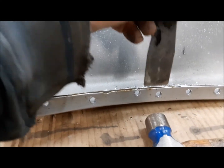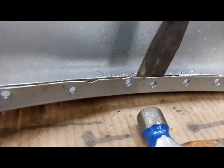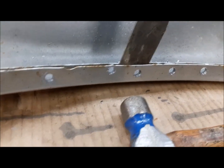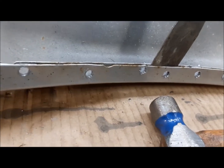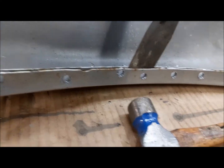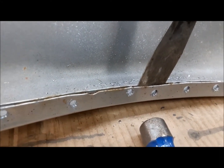Now we just start working it easy with a putty knife and a small hammer. I've gotten these three popped already, and you just keep working your way up and down. Some of them we might have to drill a little bit more. You just can't force it because once you start warping and distorting the metal, that's when you get in trouble. And the more of them you get popped, the more it is to start wiggling the thing around and the rest of them start popping real easily.